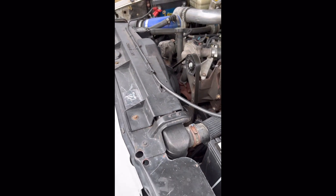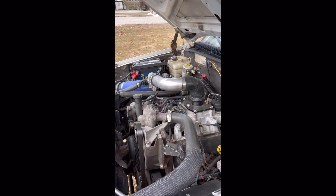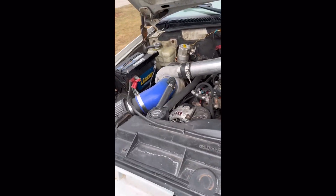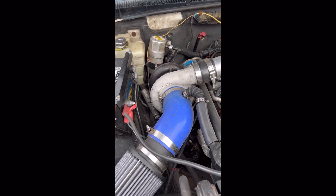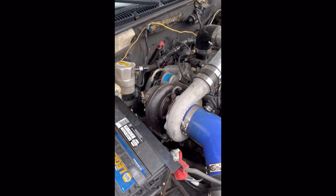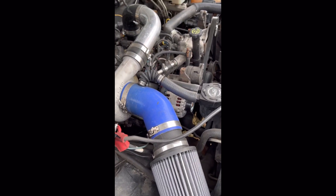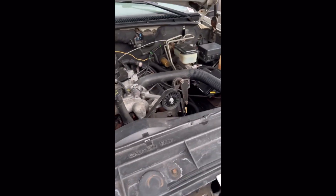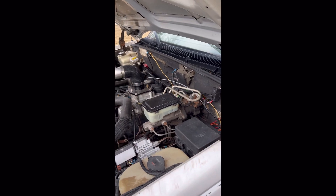Your main bulletproofing upgrades are going to be your water pump, fan clutch assembly — get all that from a 2000. Leroy Diesel sells a nice cooling upgrade package. For the turbocharger, an HX35 or HX40 is great because you reduce heat — stock turbos make a lot of heat, but put an HX on and they magically run much cooler with better flowing wheels and exhaust housing. Fluid damper is suggested, do your lift pump upgrade and lift pump relay harness upgrade.